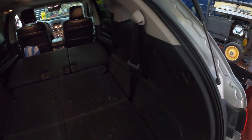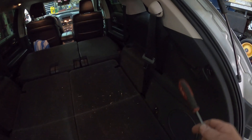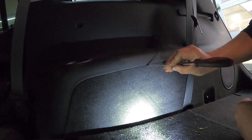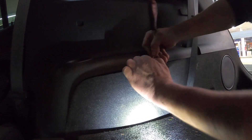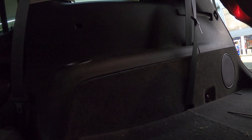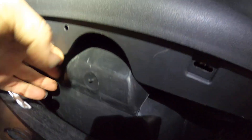Well, that is very difficult and usually these carpeting pieces do not pop off, but on this car they actually do. So you can get in here with a screwdriver and get underneath it, pop this down, and once you get that popped down, you flip this down here and the insulation — and there is the top of the shock, just really quick.